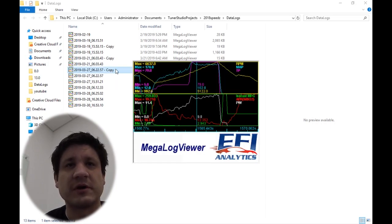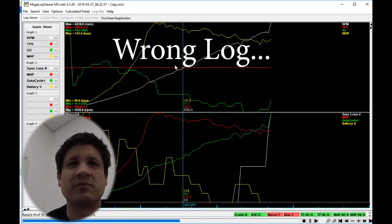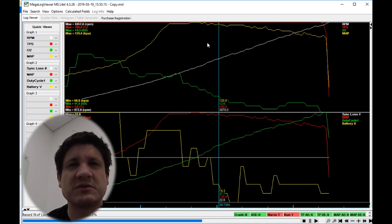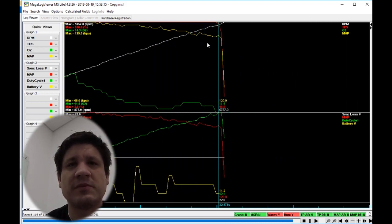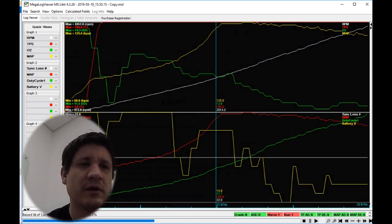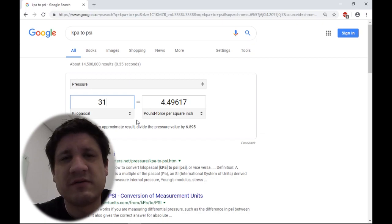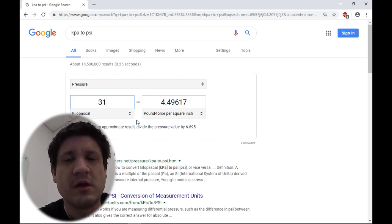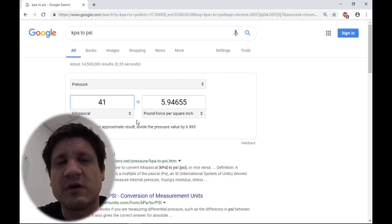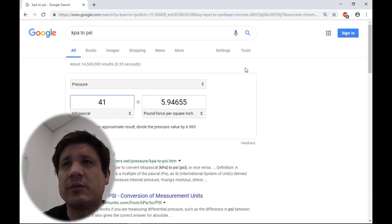One of the things I want to call out first is my wastegate pressure. A couple of people reached out to me and asked questions about this. I will bluntly say it's not that impressive. You can see right here on the 19th when I ran at wastegate, it would activate just below 130 kPa, then drop all the way down to 120 kPa. So that's not very impressive at all. At the end of that wastegate run, it dropped below 5 psi — not very good. But at the beginning it was closer to about 41, so about 6 psi, which is about what I expected. I really think a wastegate is going to help solve that.